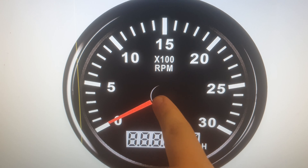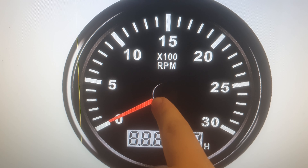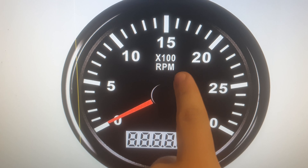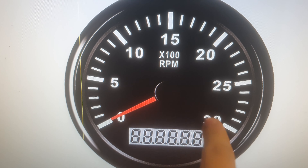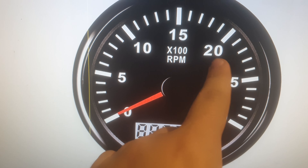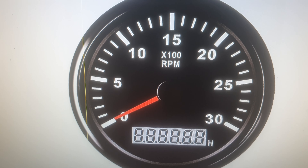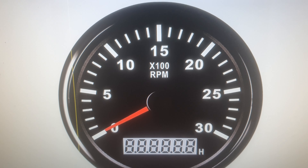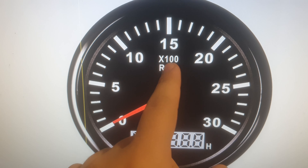I made this video because I find many people struggle with this — I hear people driving diesel cars making very different sounds when they shift, especially on uphill roads. People often rev to about 3000 RPM before shifting, which is very loud. You don't have to do that; just stick with around 2000, or maybe a little more on a really steep hill. Diesel engines don't need high RPM — they usually have larger displacement, so they have enough power at lower RPM.